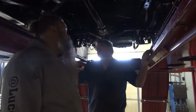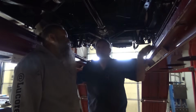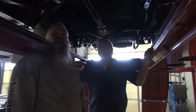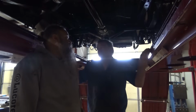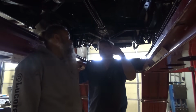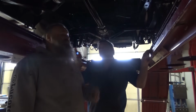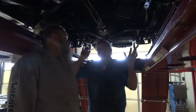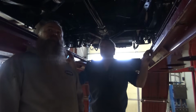Yeah. And that may also be part of what's going on, because with our weird steer on the driver's side with the rack being offset, I'm not sure it's exactly square to what the car is. I mean, I've got it square with a bracket, but I don't know that the bracket's square to what the car is. And if you look at those frame rails, both of those frame rails are completely different dimensions, so there's nothing symmetric about each frame rail. So you can't go by what you're seeing from that.